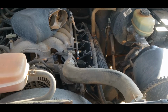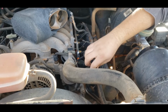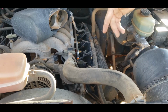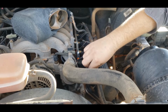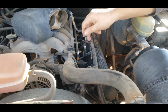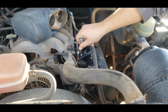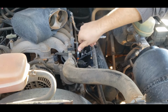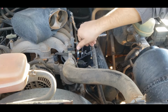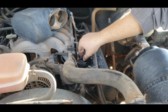First thing you need to do is, of course, unplug the ignition coil. Make sure that the plug-in is okay. This one was okay. And if you break off the little tab that's supposed to retain it on the coil, that's why you bought all the extra connectors. So come in here with a 7mm or a 9/32 socket, whichever you prefer, and loosen the retaining bolt for the coil. Don't lose it.